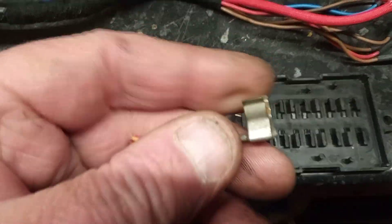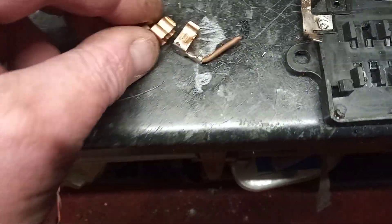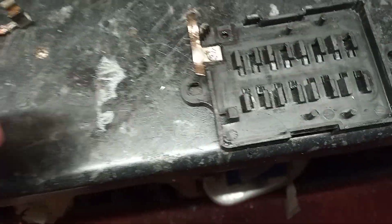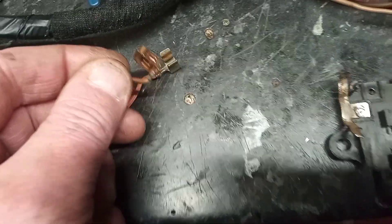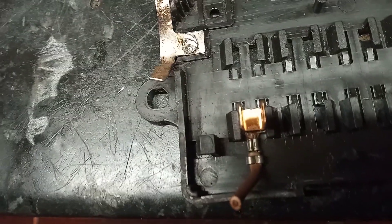Now when the tags snap off, if you're a tight sod like me you'll have a go. It's a well-known fact that you can use these things — there's a shorter one and a longer one, I prefer the longer one. What I do is solder the original spade — the bits that the clips were on before they fell off — because the width of that original plate slots in, you see, and it will stay in. That's why I do the fix the way I do it, and that's it. So the loom will be done.